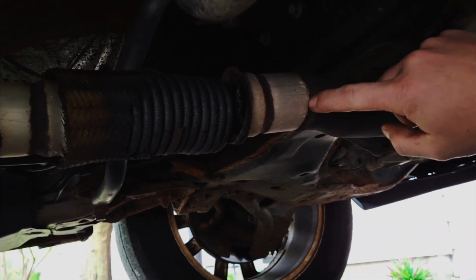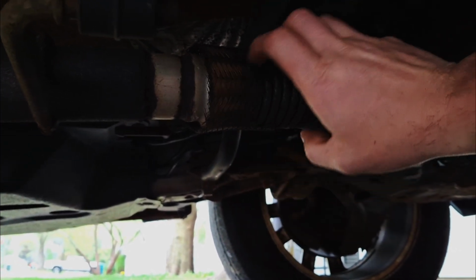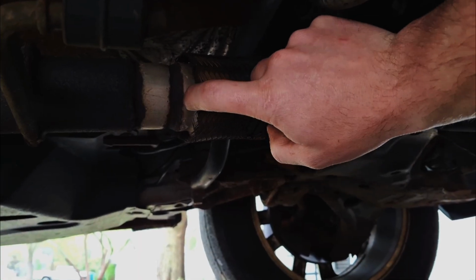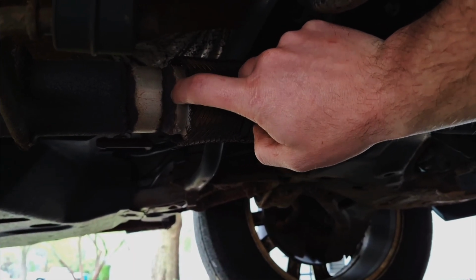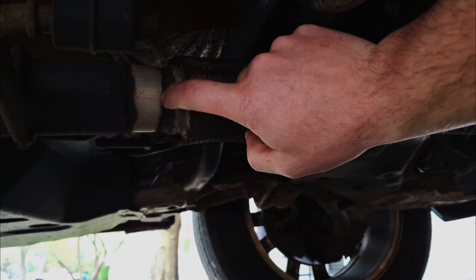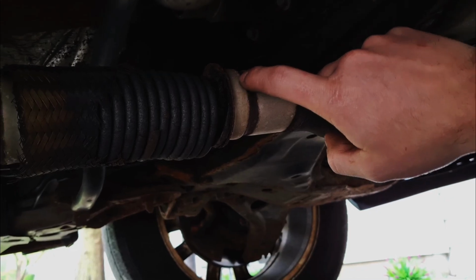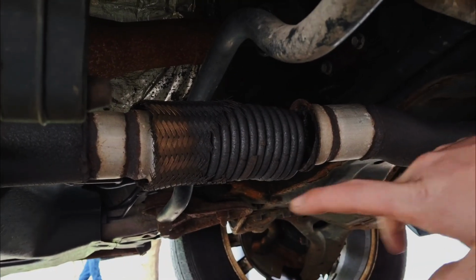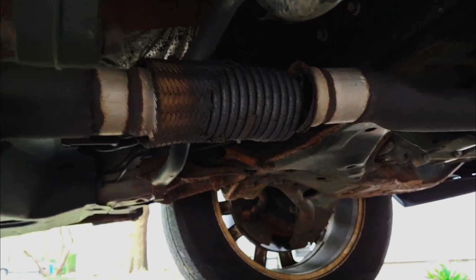So right here, this is 2-inch diameter. That's 2-inch. Again, I measured it previously before ordering the parts so that I know what size pipe to get. So I'm going to cut it basically right inside this weld. I'm okay with this being on there because I want as much of this as possible to clamp on. Same with over here. I'm going to cut it right at this weld, so I can clamp on this. After that, I'm going to measure my gap and then replace it with that pipe, put the sleeves over it. So I'll go ahead and show you me cutting it.